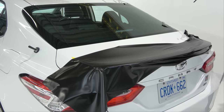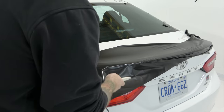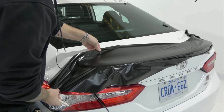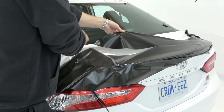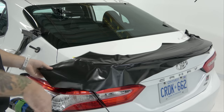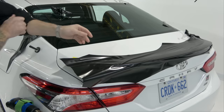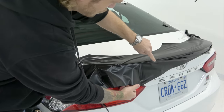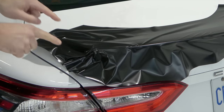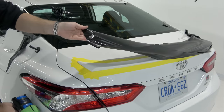Let's grab the heat gun and trim off some more of this vinyl. I don't like to have too much vinyl — it inhibits you and causes more resistance. I lift the vinyl up when I cut. I'm also a little bit long on this side, so let's trim off some of the length. Over here we haven't stretched it yet, so we still have bunching up. This vinyl is going to bunch up as we push it down and around the bottom of the spoiler, especially right here — that's why we have to pull it across and up to this corner. Again, the film is not tacked to the spoiler yet, so this shouldn't leave any lines or inconsistencies in the finish.